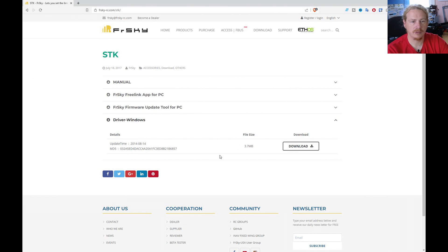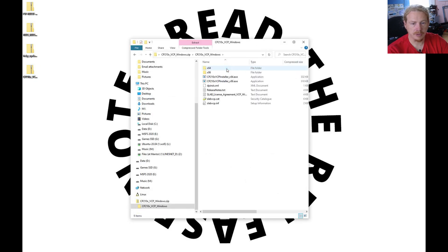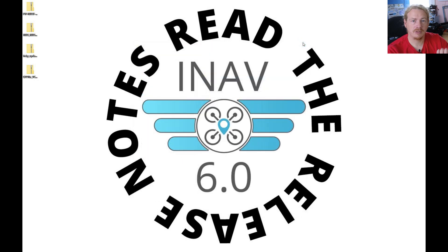The driver hasn't been updated for a long time so you might be fine, but I'll show you how to install it. The first thing you'll probably want to install is the Windows drivers. It'll just be a case of installing either the 64-bit or the 32-bit driver — these days most systems will be 64-bit. To check, right-click your Start button, choose the System option, and that will bring up the screen where you'll see System Type. If it says 64-bit install that one; if it says 32-bit install the other. Just double-click it, click Next a few times, and Finish.